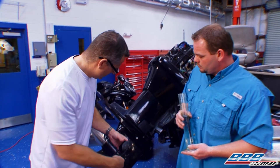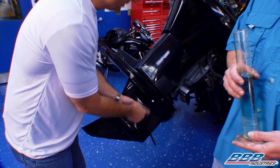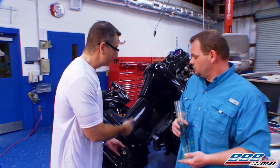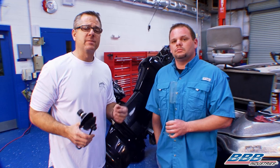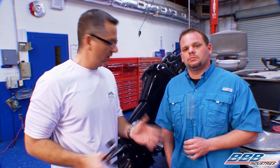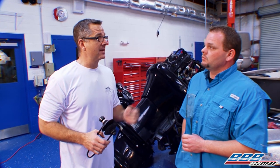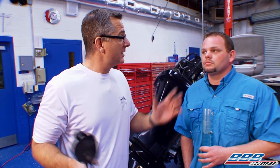You can also run your boat every once in a while using these ears placed over the intake ports with a garden hose connected — crank it up and run the water. That'll keep it running cool. Run it every once in a while. Chase also mentioned he has a trickle charger on this boat — he plugs it in and keeps the batteries maintained. Take your batteries out and trickle charge them every once in a while. All this preventative maintenance is going to make for a great fishing trip. If you want to watch more videos — UTVs, ATVs, choppers, GSXR motorcycles, tractors — it's just a click away. We're going to be putting a starter and alternator on a tractor, a starter on an ATV, and a starter on a lawn mower. Thanks for watching.